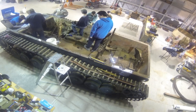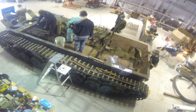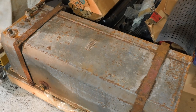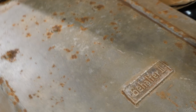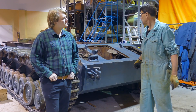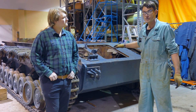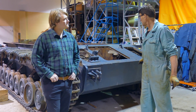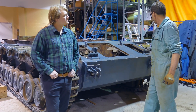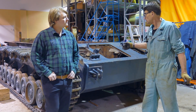We also removed the connection boxes on each side of the driver and the radio operator. In addition, we made an attack on removing the other brake arm — we were able to get that out for the right-hand steering lever. We also went underneath and removed some of the belly plates that covered up the gas tanks. The gas tanks, even though they look exposed on top, are actually not — there's a metal superstructure welded on top of them for extra protection from hot shrapnel. We got one of the tanks out today.